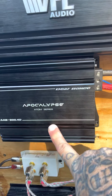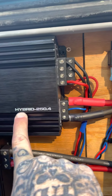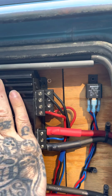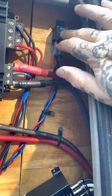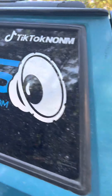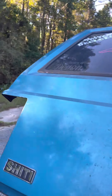A 300x4 is on my A-pillars and my tweeters. I've got this four-channel bridged into two-channel running the horns - the horns are 8 ohm, so I figured it'd be better to bridge a four-channel to them. It sounded right in my head. I put this relay in here to turn everything on because I had like eight amps and a DSP. Sam at Bear Vids did a video showing that actually takes more amperage to turn on than nine or ten amps, so I just left it.